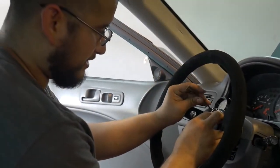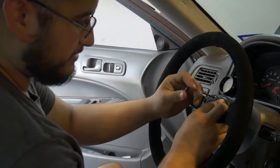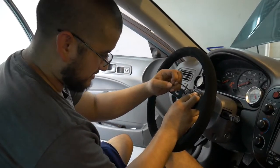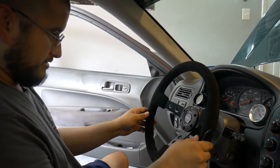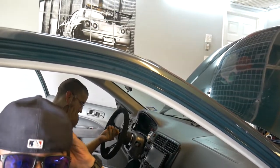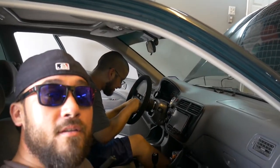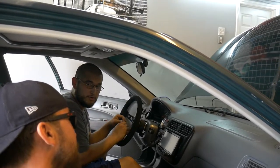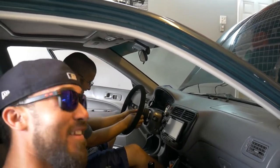It's kind of a lot to line up — you have to line up the horn cover plate, the horn itself, and the steering wheel, making sure it's all lined up to the hub behind it. But the wheel is going on and it looks pretty good. Had a little hiccup with the cheap hub but it's going to work out. Got the horn working, airbag light bypassed, and we're buttoning it all up. He's hit the horn probably about a hundred times, so it definitely works.